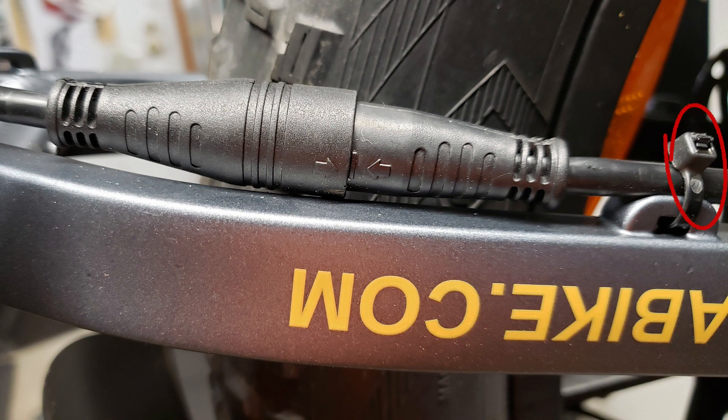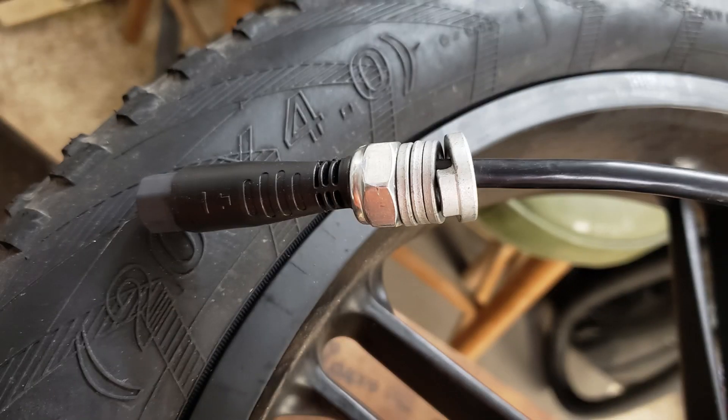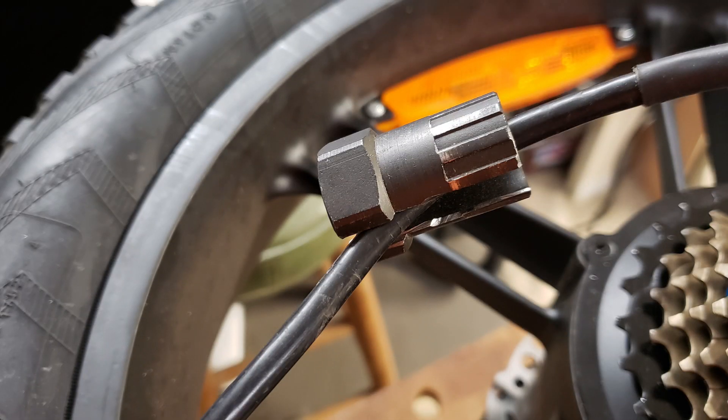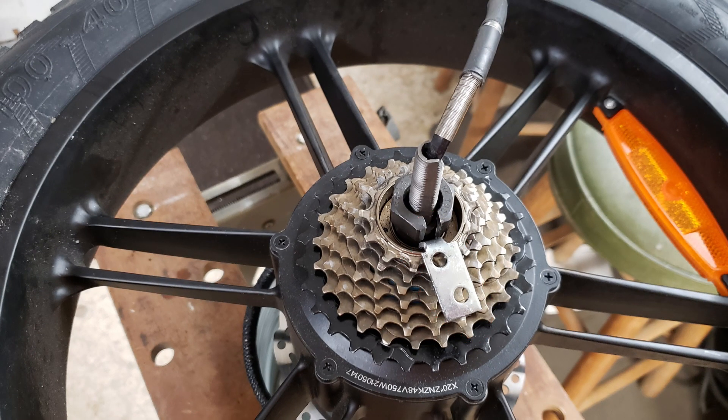Also remove the two tie straps leading to the motor. To my surprise, the motor power cord connection coupler is too large for the axle nut and washer to slip over — this creates a problem, because you have to slip the freewheel removal tool over the coupler and cord to reach the freewheel. I had two choices: either cut the cord or modify the tool. I chose to modify the tool. I took a hacksaw and cut an open gap in the freewheel removal tool, wide enough to slide the cord through, bypassing the coupler, nut, and washer. I then made a wedge to fit into the tool's opening slot to retain enough pressure to keep the tool from slipping.